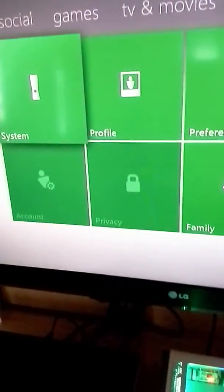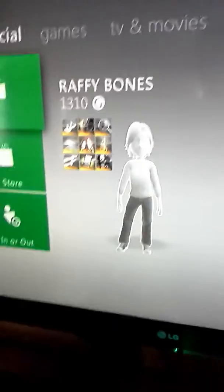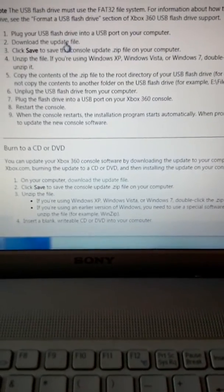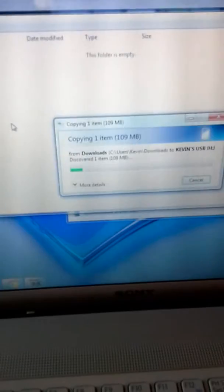Now I'm just going to download a few things to show you how to update the avatar. The avatar is blank and a lot of games will freeze because of that. I'm going to go onto the website and download the big file and show you how to do it. The Xbox is on perfectly. Go to the Xbox website — I'll put the link in the description below. Click this here, download the file. It's actually a pretty big file, 110 megabytes. When it's downloaded I'll show you what to do. Now we extract it to the USB and transfer the system update file over to the USB.